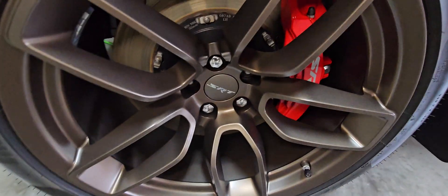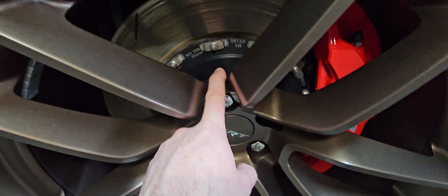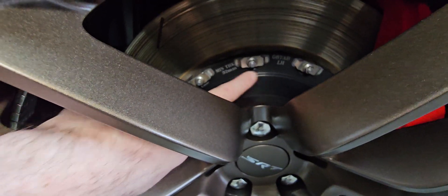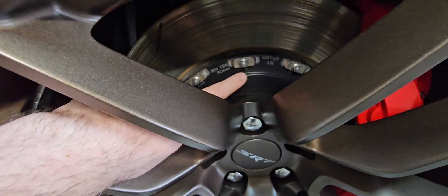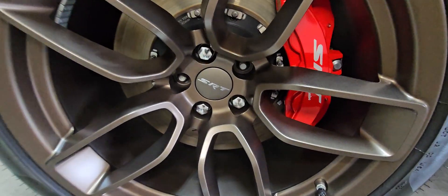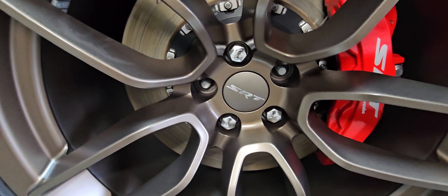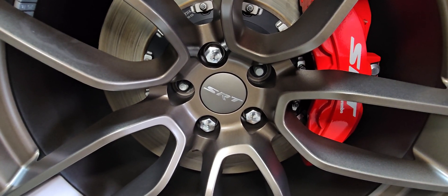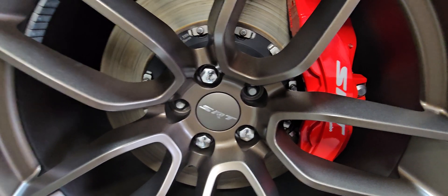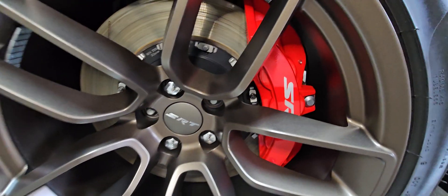The other thing that's super important, especially on these cars, is you have to clean the back side of the rim and the front side of the black disc holder — so that there's no debris, dirt, sand, or grit between the rim and the disc. That has to be super clean. If there's any kind of debris there, you're going to get really weird noises when you're braking. A lot of people online complain about that, and that is the solution.